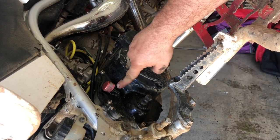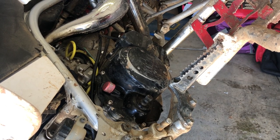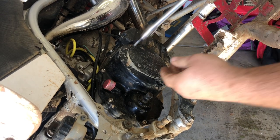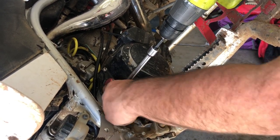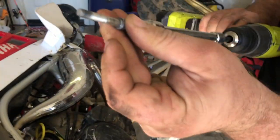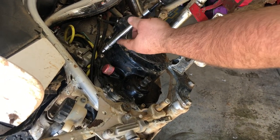It's leaking because of this — there's an o-ring that's messed up here, not because the case is loose. This bolt right here, you can reference it next to the dipstick — it's longer than all the other ones. That is your only longer bolt; it's not threaded all the way. All the other ones are the same length.